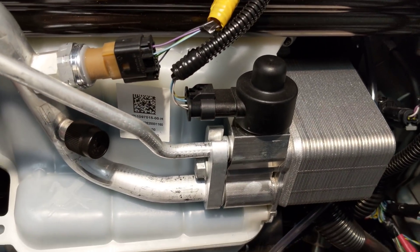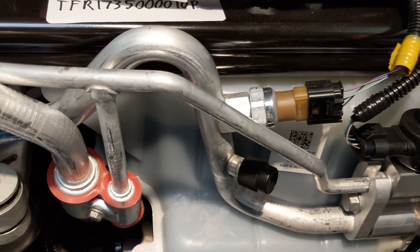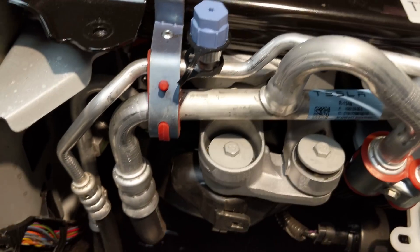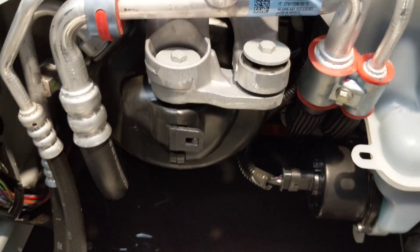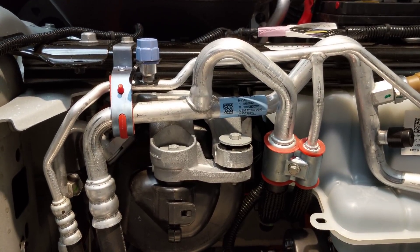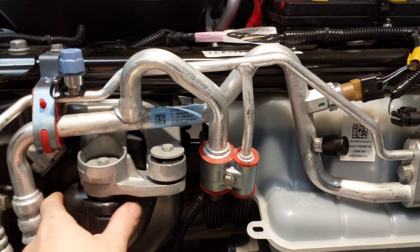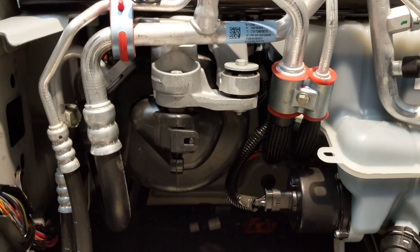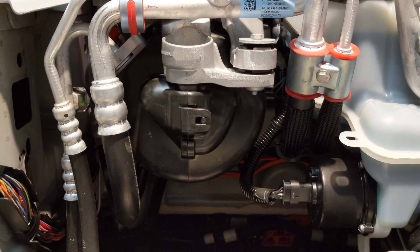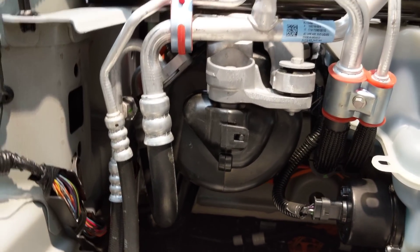That black thing on top is the valve controlling the refrigerant. We've got a pressure transducer there on the low side. The AC compressor is down here, mounted on this cross member with rubber mounts. They've really done a job on the mounts — it's nice and soft. They've got an injection-molded plastic housing snapped around it; I would guess that's lined with acoustic foam or something. They really wanted to make that quiet.